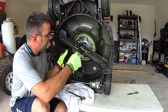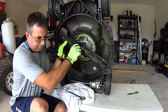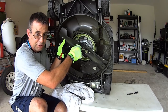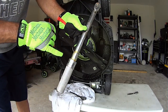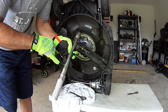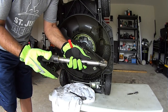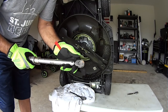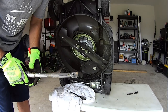The book probably gives a torque spec, and 99% of you don't have a torque wrench. A torque wrench has graduated numbers — this one goes up to 1,000 inch-pounds. To convert foot-pounds to inch-pounds, multiply by 12. You loosen the handle, twist to the number you want, lock it down, tighten, and when it gets to that torque it'll click. The book says 36 to 43 foot-pounds, so I split the difference at 40 times 12 — that's 480 inch-pounds.